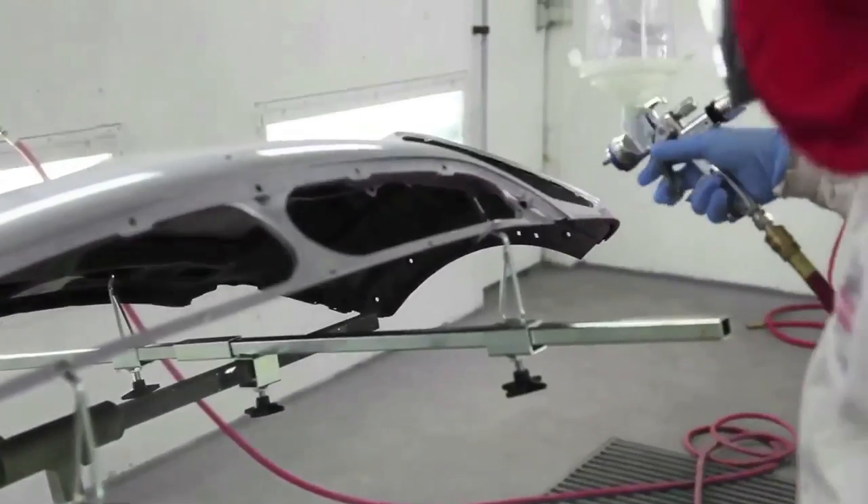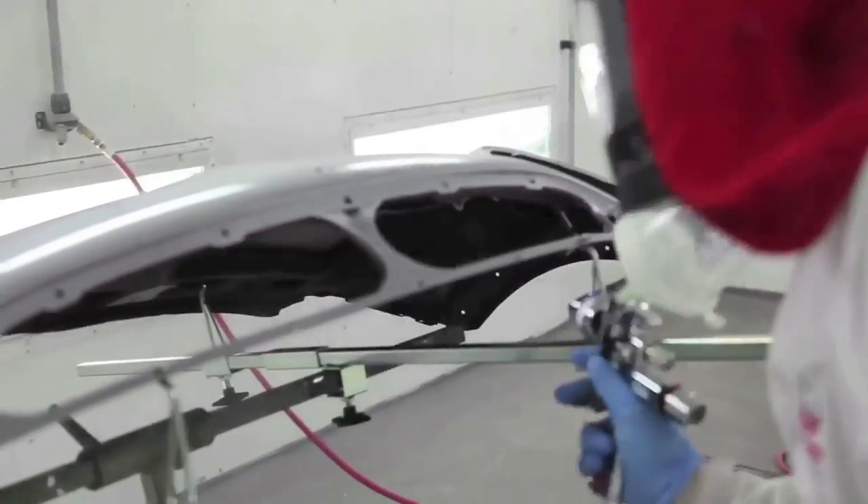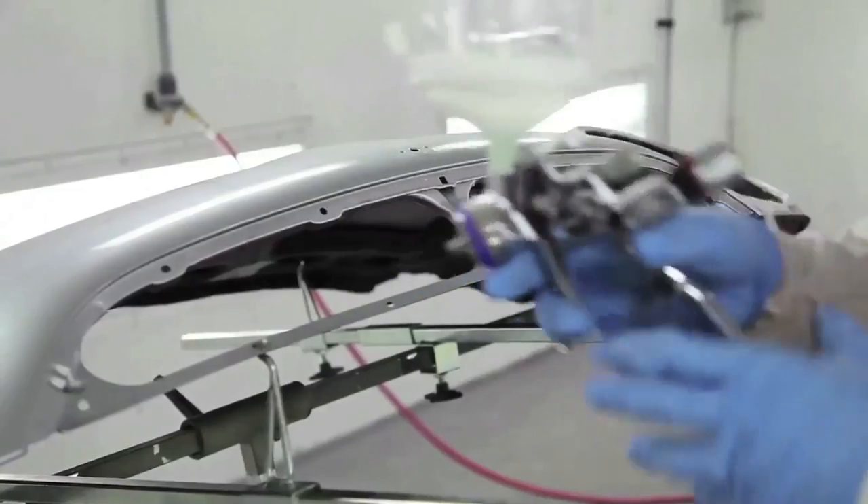On a clear coat gun — if I'm going to spray with this RP-4000 and shoot clear coat — I can spray a little lower, maybe at 26 pounds. But if I've got 70 coming to it and I cheat it down, I'm going to have the problems we talked about. If I leave the micrometer open and instead of setting it at 26, I leave it at 30, I can micro-adjust a little bit. That way, as I'm painting down the side of a car and lose a little pressure, I have room to open it up — without closing off that air micrometer.